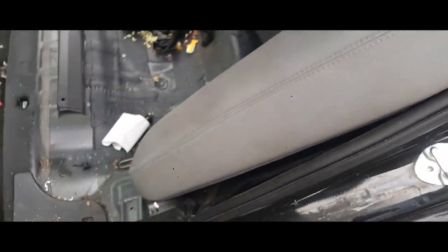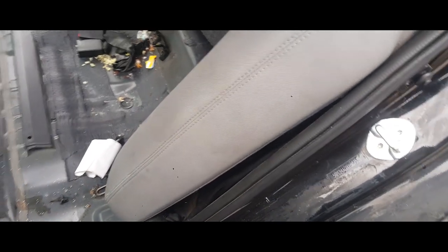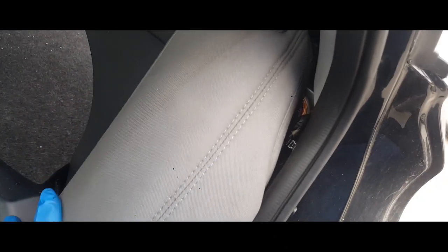I just wanted to mention how you remove these headrests since I already took them off. You just push these up all the way, remove the seat belt, and now they come out — they're just sitting in here right there. That's the only thing that's holding them down.